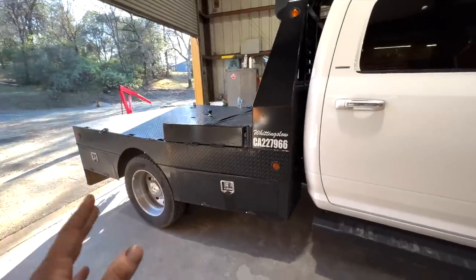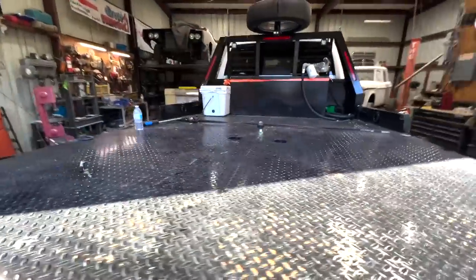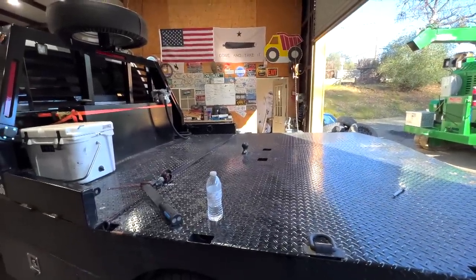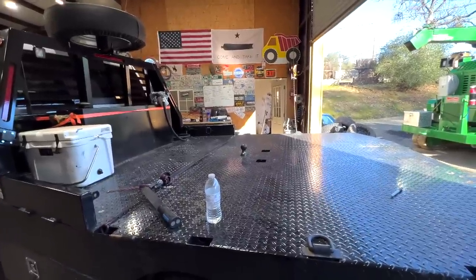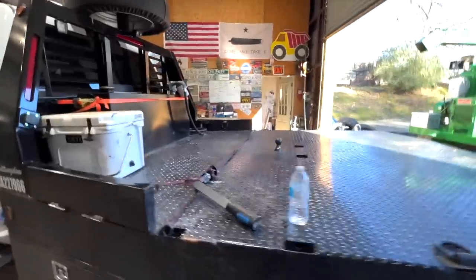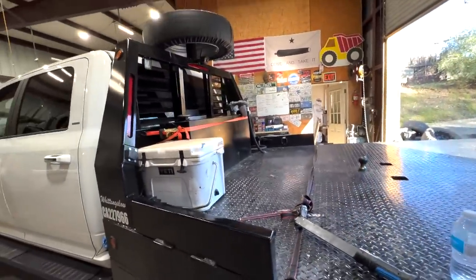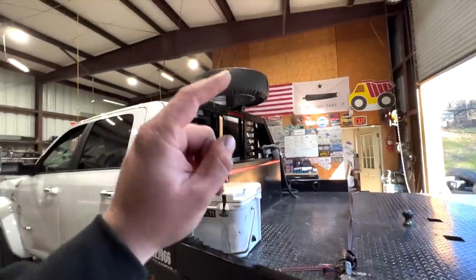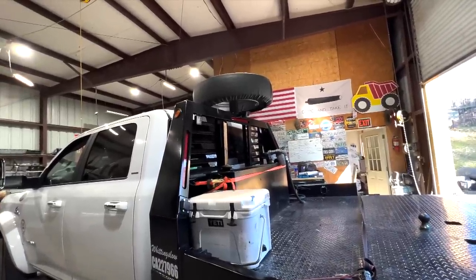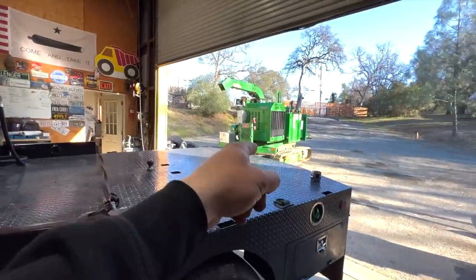It's got a Great Northern flatbed on it and I've done numerous fabrication upgrades — beefing stuff up underneath. For the price of the bed, they wanted double to add boxes underneath, so I went ahead and built my own boxes. They worked out slick — I've got living quarters pretty much, a hot lunch maker, all my gear fits. B&W turnover ball on the back. I'll show you why I got the turnover ball — we're going to have to upgrade the 2-5/16" ball to a 3" ball because that ball doesn't go to a 40k trailer; that's a 30k trailer. Running a 37-gallon transfer tank, I need to get a bigger one — I'd like to get a wedge-shaped one but they're tricky and expensive. My signature spare tire is up on the top — most effective, efficient, purposeful place to get it out of the way since the fuel tank's back there and there's no other spot.